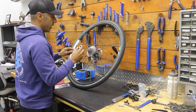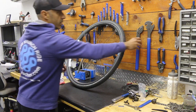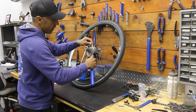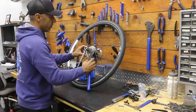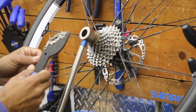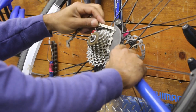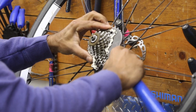I'm going to stick that in there. I usually like to work flat, but this might be better for video. This is a shop-style chain whip — you want to start on the right side. I like to engage the curved part first and then wrap the chain around. Depending on what style you have, the angle might be different. Basically you need to stop the cassette from spinning — choose somewhere in the middle, and the more chain wrap you get, the better.